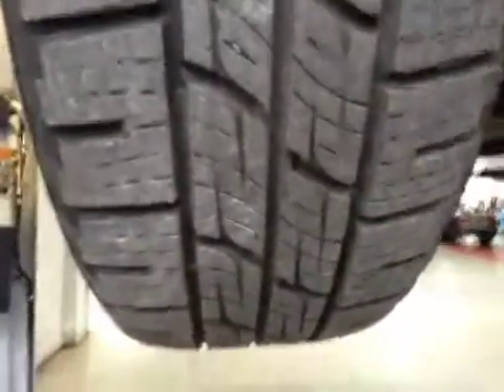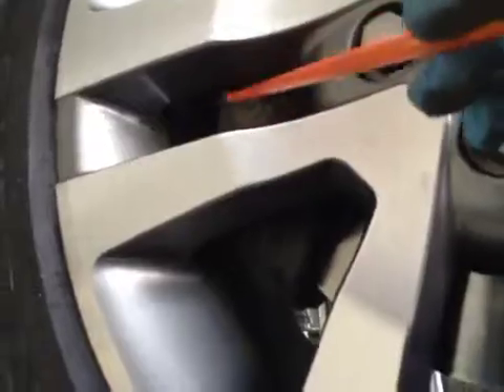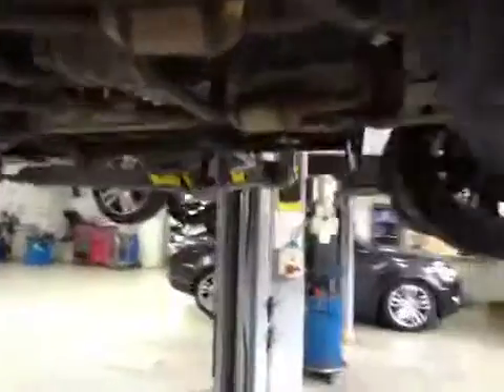This is the driver side front tire — tire is in amber, no signs of foreign objects inside the tire. The front disc is in okay condition and again your front brake pads on this side are on 2mm, so pads are in red, discs are in green, tire is in amber.